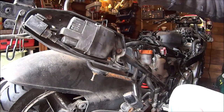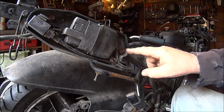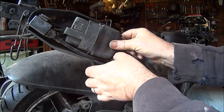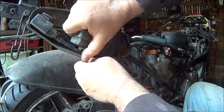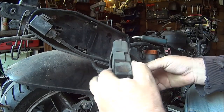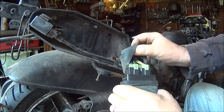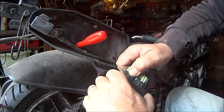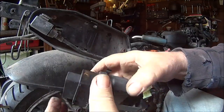So now we can try to remove the CDI unit. I think it's just sort of clipped in there really, but there is a 10mm bolt there and a 10mm bolt there. Let's just see if we can get it out of the bracketry — plastic bracketry. It's just some clips — two plastic prongs that go through the holes. Let's try and find the connectors. That's one out — still out. There's this little gizmo out, again on another plastic tab.